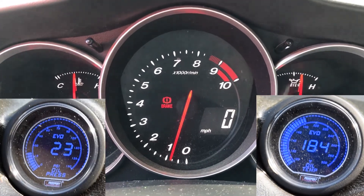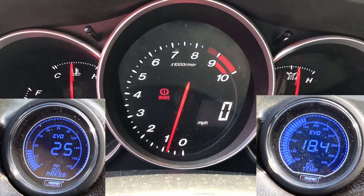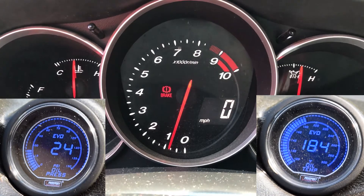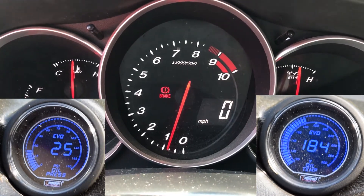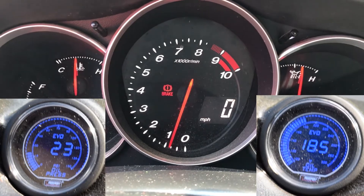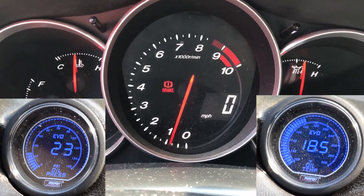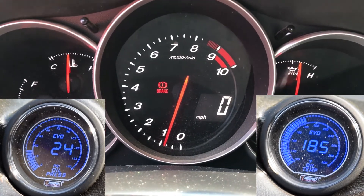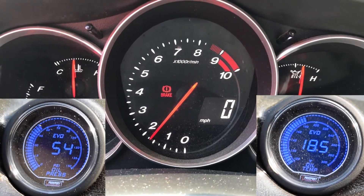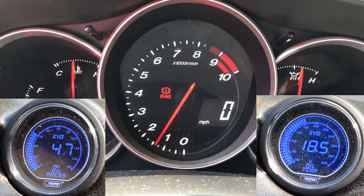All right, I'm back — we've fully warmed up. If you look at the oil temp, we're about 184 right now, idling about 750 to 850, bouncing because it needs to be tuned. Sitting about 25 PSI of oil somewhere in there, just a touch below a thousand. Let's bring it up to the RPM where it's going to be tuned to idle — this is a little difficult because it doesn't really want to sit that low.